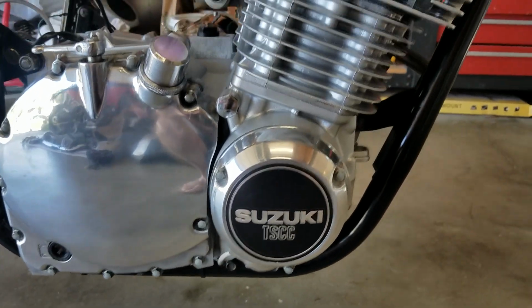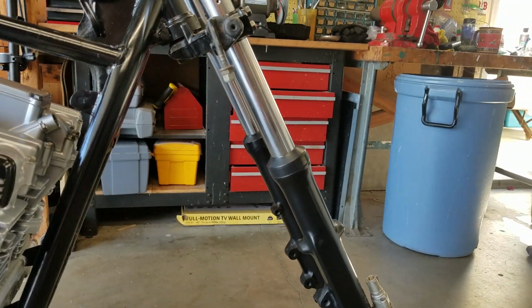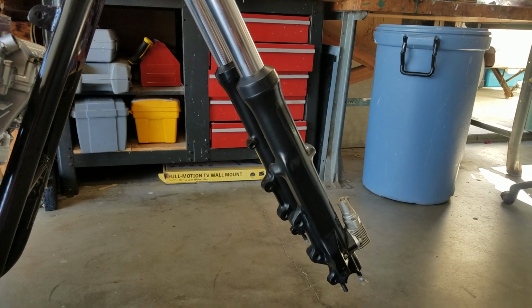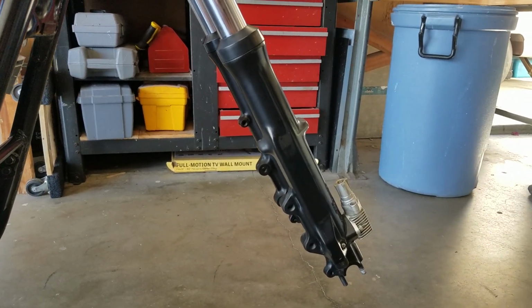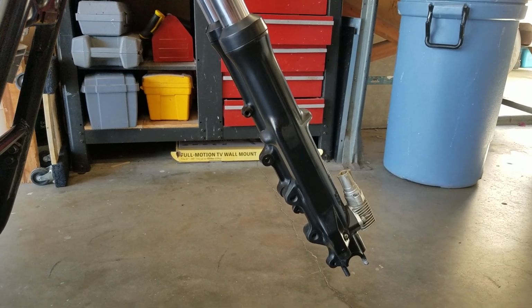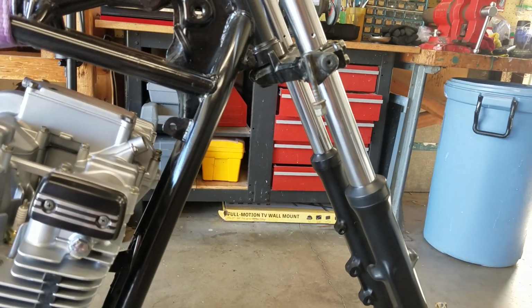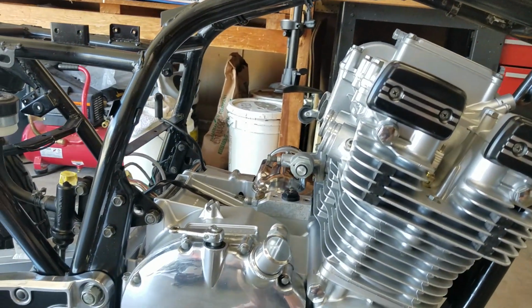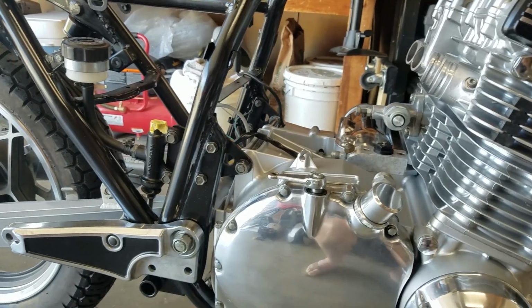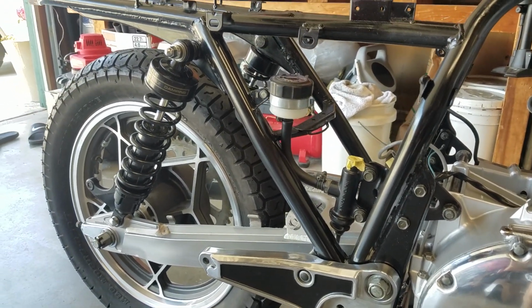It's crazy. I've redone the forks with new bushings and seals, and there's a couple of pits, but I think they weren't leaking, they were holding air. Anti-dive gimmickry, I'll plug that off, put some stainless hoses on it. I buffed up the fork legs and made sure everything was good and sound. What's nice is all the parts, I have duplicates of a lot of it. Brake parts and bolts and engine parts and carbs and stuff.